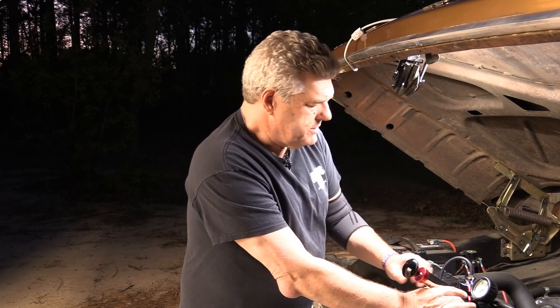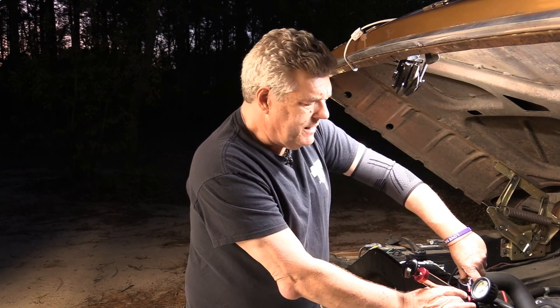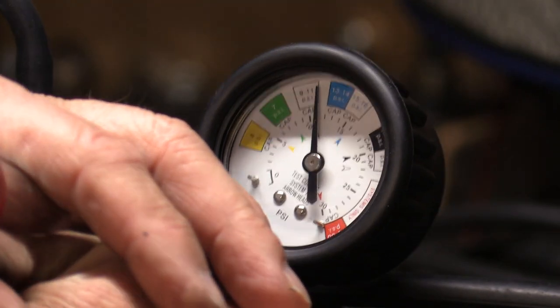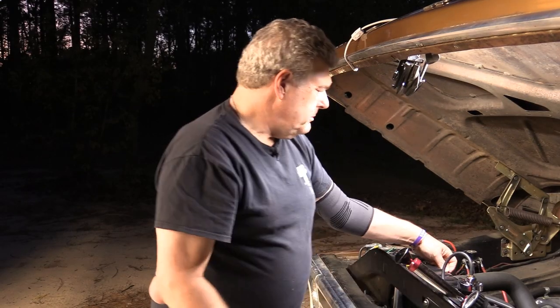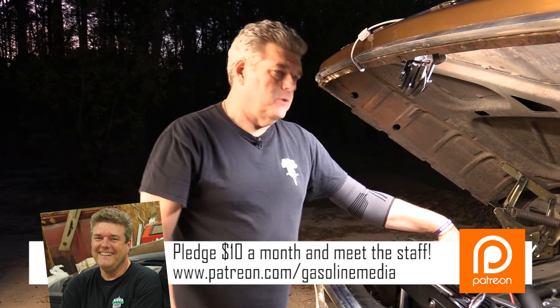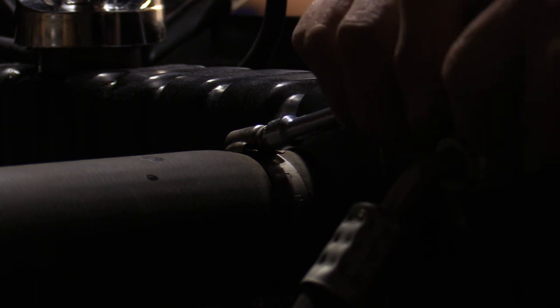What I'll do is go in now and tighten this up. I'll leave the system pressurized — I might drop a little bit of pressure back down to 13 psi. I'm going to go to the tool and tighten that up, and hopefully that'll stop this. I hope it's not a cracked radiator neck — I hope it's just a tension point on this hose here. Bacon.